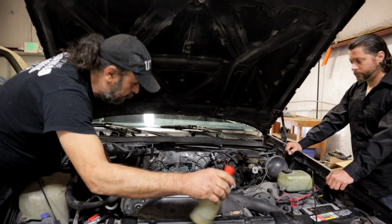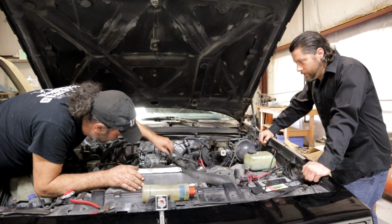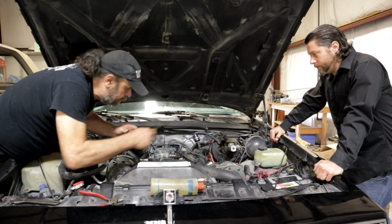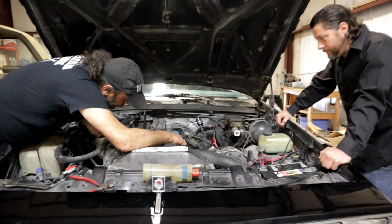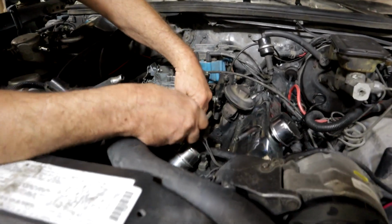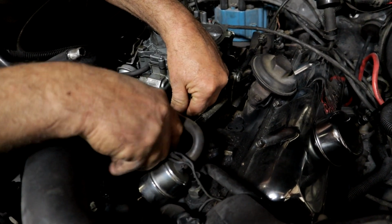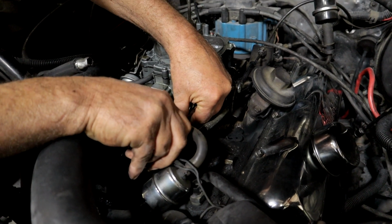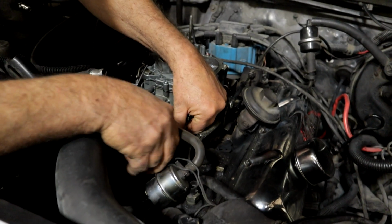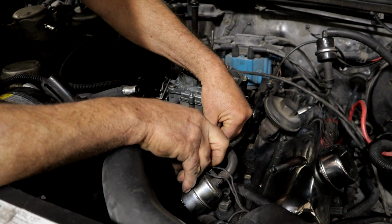We still, now did you screw around with these idle mixture screws down here at all? Not a whole lot, no. Okay. But you did? Did, yes. Okay. So let's see what we got here. I think they're flatheads, right? Oh, that's closed completely. All right, so I'm gonna go 2 turns open. Okay, that's closed, right? So that's 1 turn.